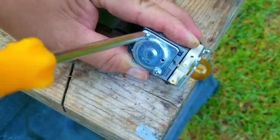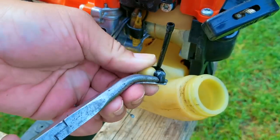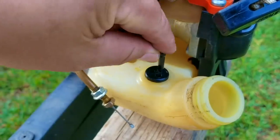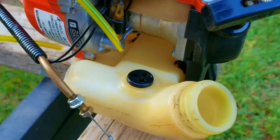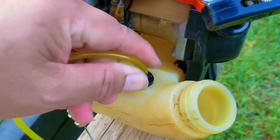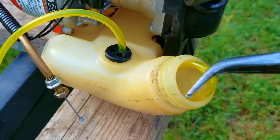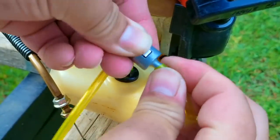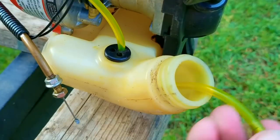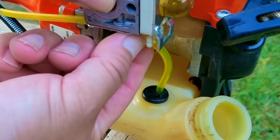I would normally replace the primer bulb as well; however, on this type of carb we can easily change it at any point afterwards, so I'm going to save film time and do it later. On this type of fuel tank, the fuel cap does not have a built-in air vent — instead, the vent is installed on the third fuel line coming out of the grommet, which is the reason for the extra fuel line. I'm going to switch over to a yellow fuel line. If you're having a hard time finding fuel lines, there should be a link in the description to help you out. It does not matter which opening you use for the filter line, the return line, or the air vent. Cutting the lines at an angle will help get them started in the opening. Just make sure the fuel filter line is long enough so the filter can reach the other end of the tank, so the engine does not starve of fuel while being used on its side.